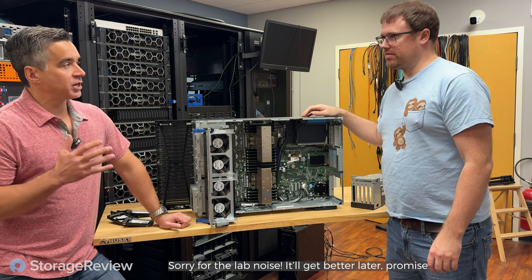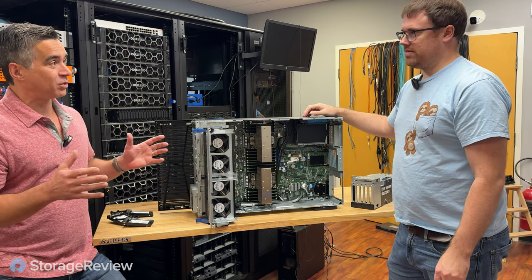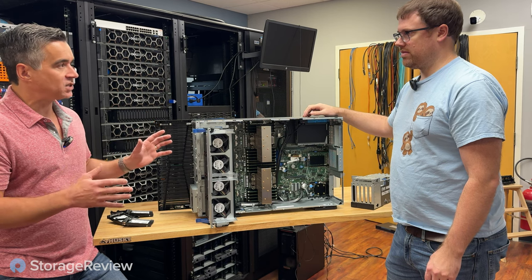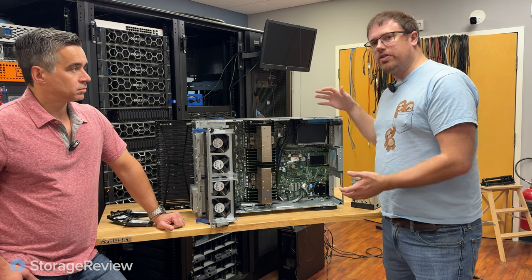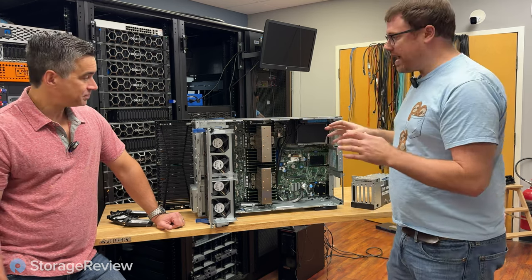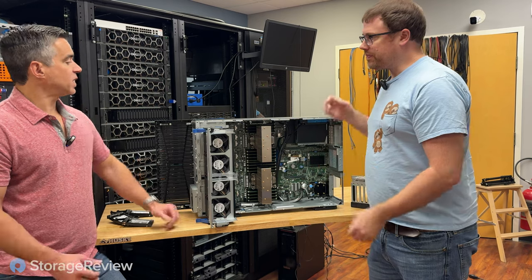One thing that's been really interesting as we've looked at the new generation of tower servers is that they're actually pretty darn configurable. We saw that in the Dell T560 — tons of options there. I've always thought of towers as being less configurable — our very first server was a tower 18 years ago and it wasn't super configurable back then — but they sometimes can feel like a desktop PC more than a server. This has got a ton of server stuff. A tower is roughly the same footprint as a normal server, but the advantage is it's a lot taller. It's like a 4U box — actually a 5U when you put the rail kit on. There's a ton of space in here, which gives you some impressive storage options since storage takes up a lot of physical space.